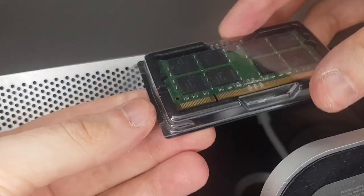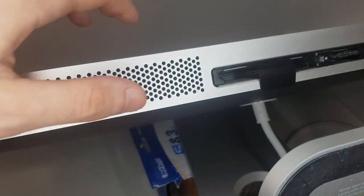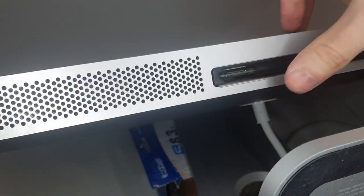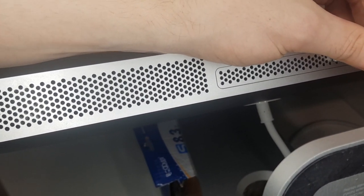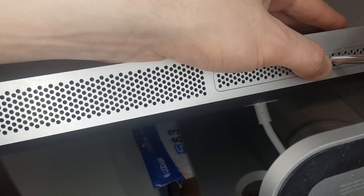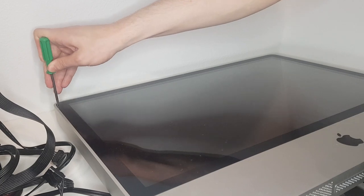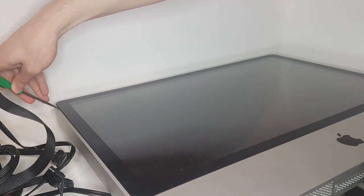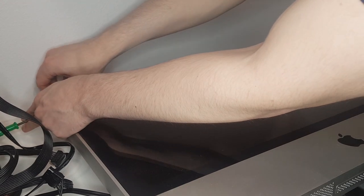There is an unofficial patcher, which allows installing macOS on unsupported Macs, but this Mac also requires a CPU upgrade to support Catalina. I'm also upgrading RAM and installing an SSD. This Mac has an official RAM capacity of max 4 GB, but in fact it can take 6.